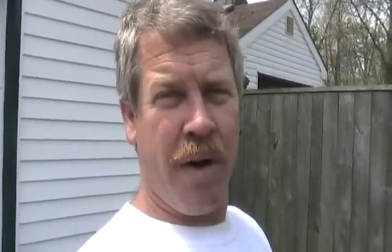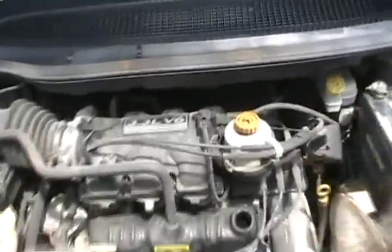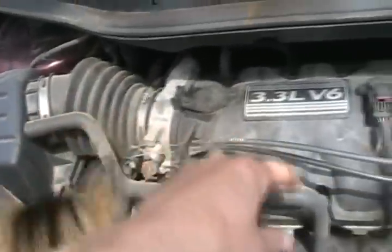You get water back because fuel is made of hydrocarbons — hydrogen and carbon — and the hydrogen is combined with oxygen to make water. Every engine also has some blow-by. Blow-by is what goes out the PCV tube and gets re-burned in the engine.